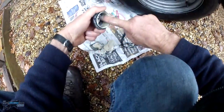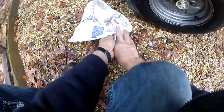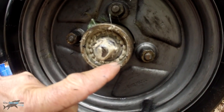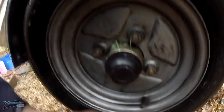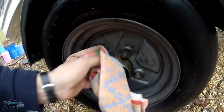I take out the emulsified grease — which is caused by warm bearings going into water after a long tow — and put it on some newspaper. That way you can fold it all up; you don't get grease over everything, your clothes, the gravel. You can screw it up in some newspaper. Pump in extra grease — I just use old-fashioned grease. Watch — that's pushed out some more salt water. Those little bobbly ridges there are grease pushed out by the new grease going on the inside of the hub. I wipe off the surplus, there's now no water in there. The grease has pushed it out from the inside out. I put the hubcap over the top, wipe it clean — ready for use next time.